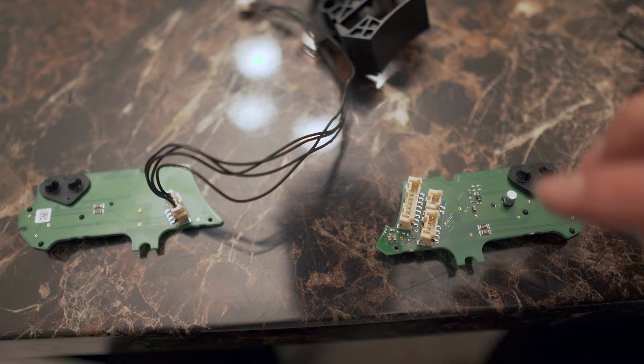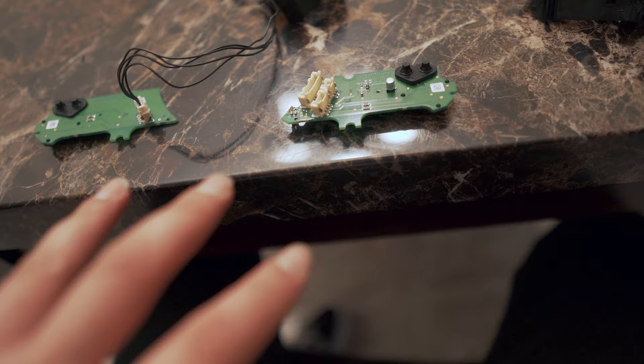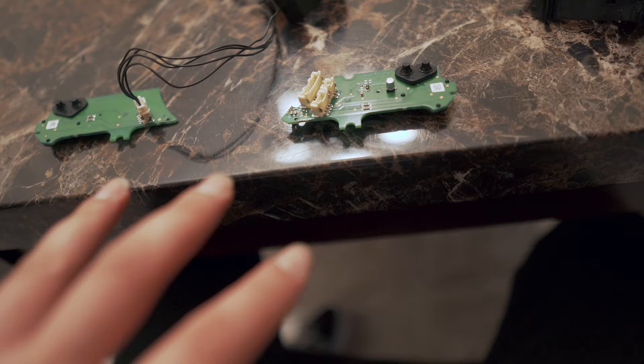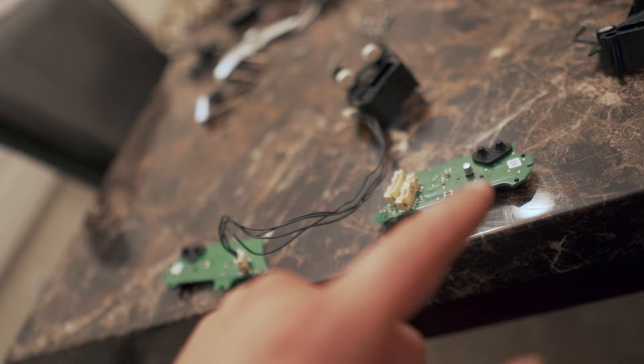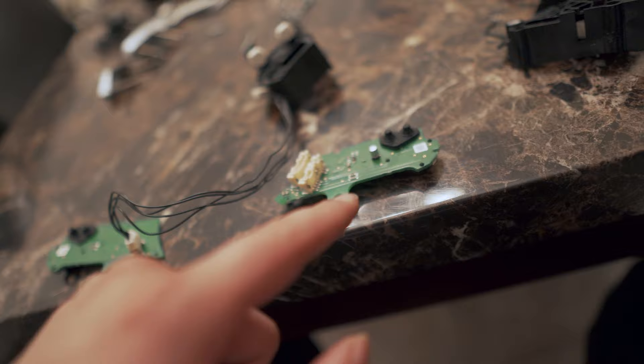This is the motherboard setup. There is one 8-pin connector on the right side, a 2-pin connector, a 4-pin connector, and then one 4-pin connector on the left side. This is where our wiring diagram significantly differs. You can trace and follow the leads to figure out which one does what, however they're bridged together — it's like this is the parent board and this is the slave board. What you need to figure out is how to cancel some connections and invert the signal from one to the other.